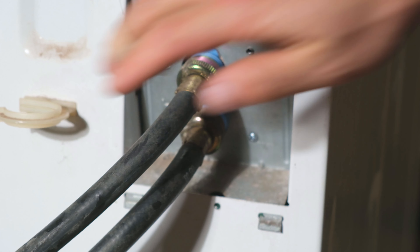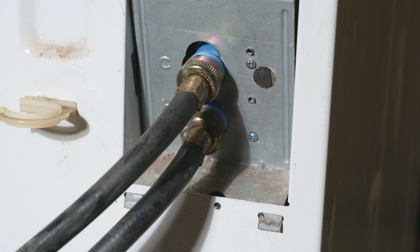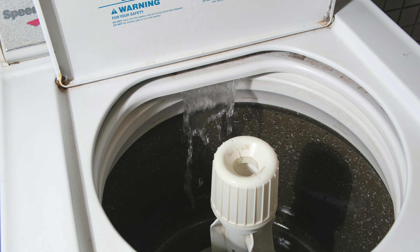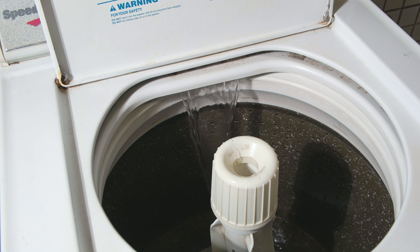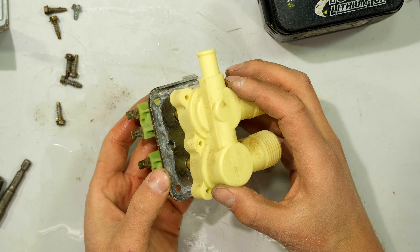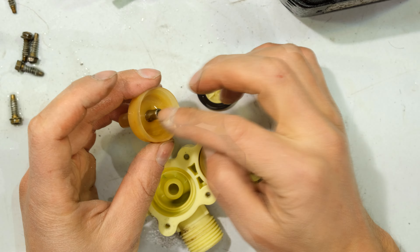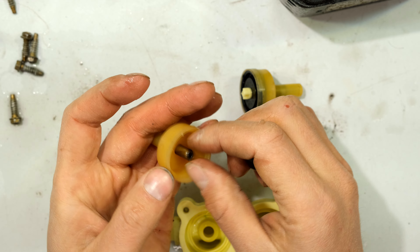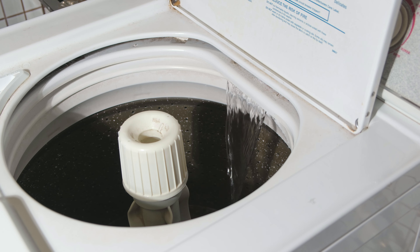Make sure it's dry around there, then turn on the water to check for leaks. Inspecting - there is no water, it's bone dry. Now putting the machine back in place. Turning the machine on - that's a good stream for the cold, and there's the hot water. The machine is now fixed. Sometimes it's worthwhile to open the solenoid and fix it, but in this case there was definite damage and it was not worth repairing - it was only opening partially and only allowing a little bit of water through. It was worthwhile to just replace the solenoid.